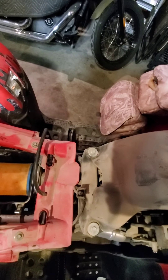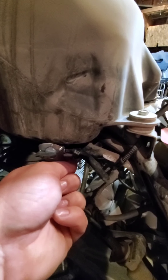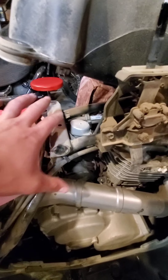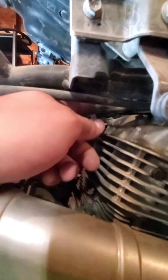You'll have to undo the fuel line. You're gonna have your fuel petcock right here with a line attached that goes down into your carburetor. The hose clamp is like a plier tab — you squeeze them together with pliers, pull it, and slide it off. I like to replace those with screw-type clamps, they're a little bit nicer. Make sure it's in the off position. We went ahead and removed the two 10-millimeter bolts from the top of the gas tank. The gas tank will lift out, but I'm going to leave it as-is since it gives enough clearance to work out the carburetor.